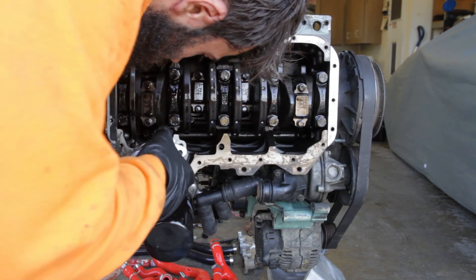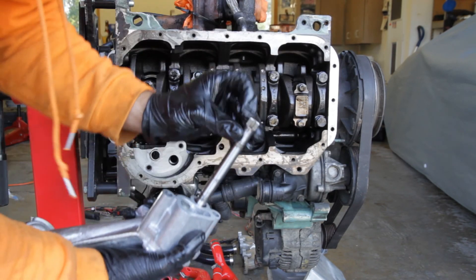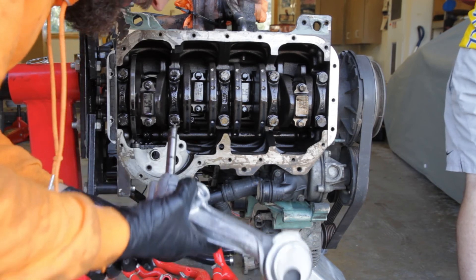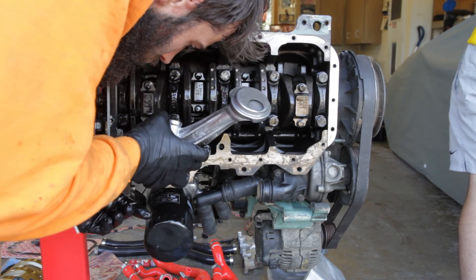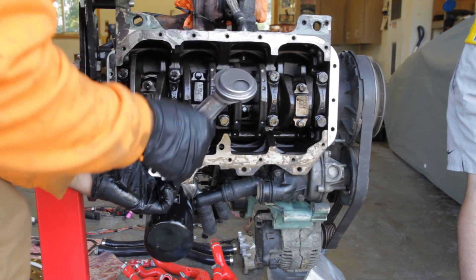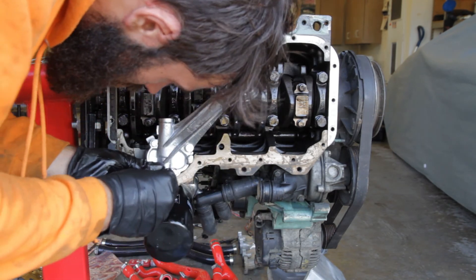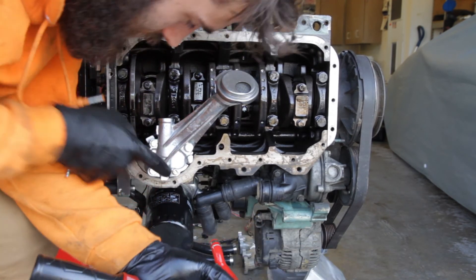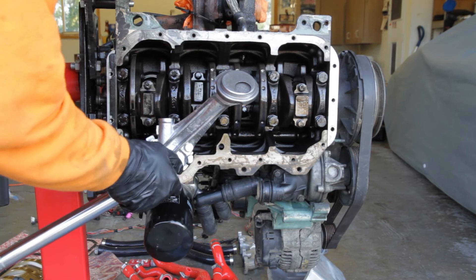There is a drive shaft, kind of, and there is a key. You're going to want to make sure it goes into that. You see there's a little line on one side, and I'm sure inside of it has a little bit of that line also. It looks like it kind of goes like that. There we go — sick. That is not bad at all. I don't feel any play, so that should be perfect. Okay, so we got those crush washers and the longer bolts, they just go in there, nothing too crazy. 20 Newton meters for these two bolts right here, and then all the oil pan I believe is seven.